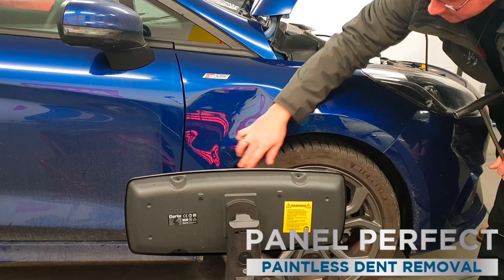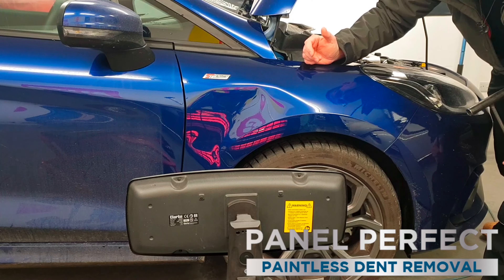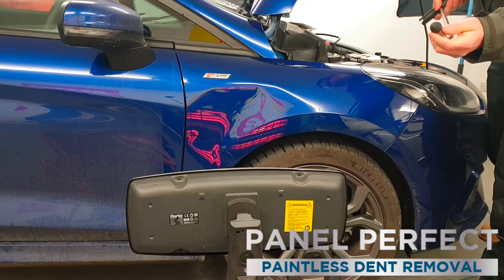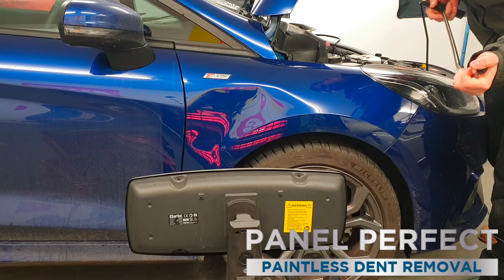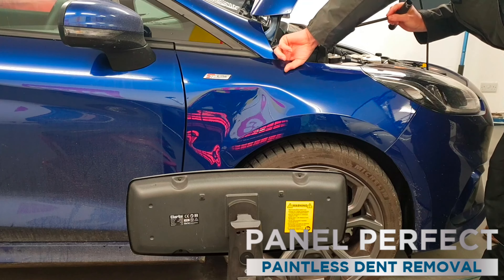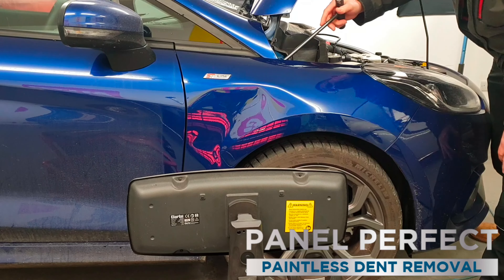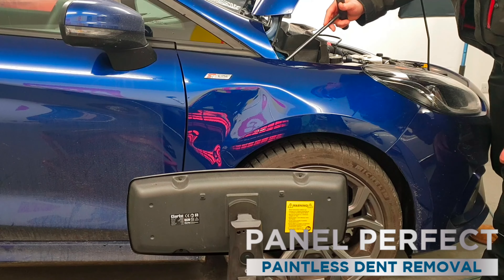I'm actually going to push it rather than pull it — here's the initial part of the repair. I'm going to release the pressure up here, here and here, which should just release enough of that centre metal to lift it up. Looking at the shape of the damage, I'd suggest that's where I've got the most tension, so I'm going to release that first by sticking one of the tools with a nice soft tip on it. You should never push with anything sharp like a screwdriver. I'm going to pop this inside the top of the wing here through a nice clean hole. We've got a heat lamp on it as well just to keep the paint fluid.